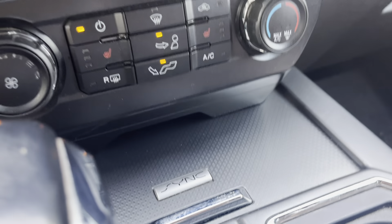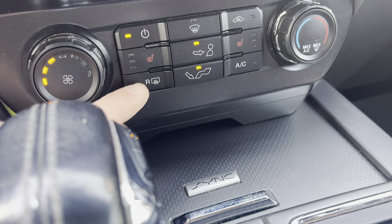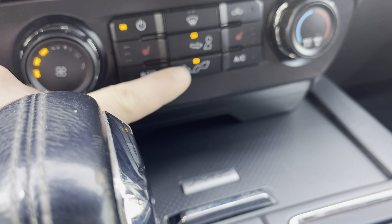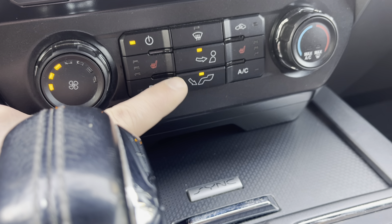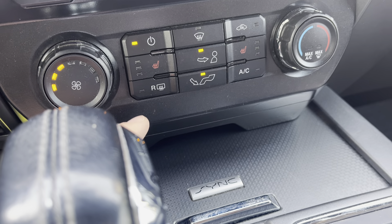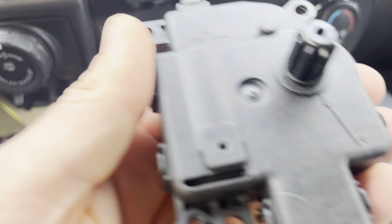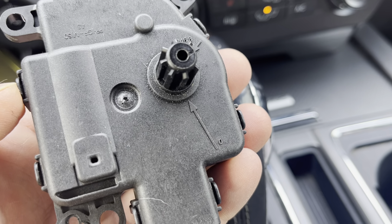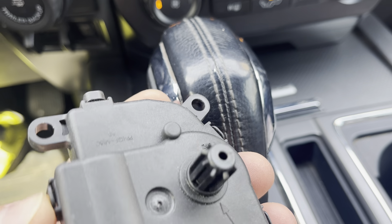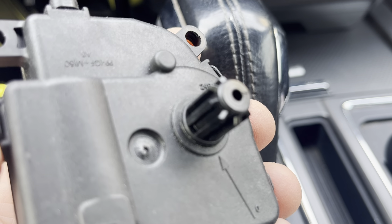Just play around toggling between the various vent combinations. In my case, it was failing by blowing dash air constantly, so I could never get defrost. Just keep that in mind — toggle to figure out which position you're at, and that'll help you when fastening. It's a pain to get under there and finagle yourself into position to see and loosen those screws, but once you figure that out it's pretty straightforward. I hope that helps, thanks for watching.